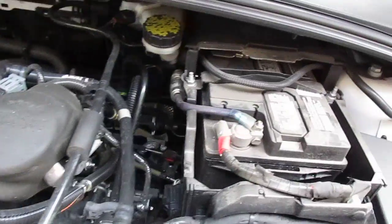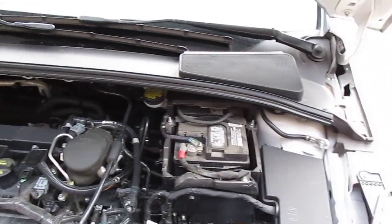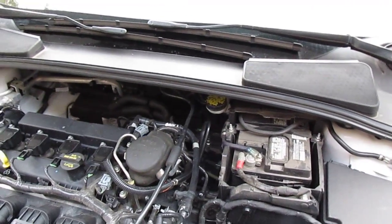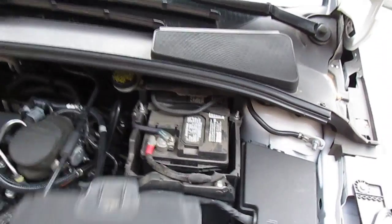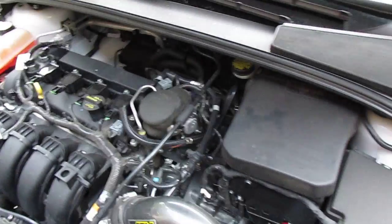So this is a 4 gauge audio kit. I don't ever recommend using anything smaller than 4 gauge, but anything bigger than 4 gauge isn't really needed until you start doing some crazy stuff. It's all personal preference and how much money you want to pay.